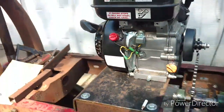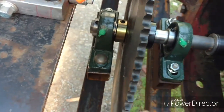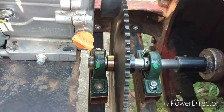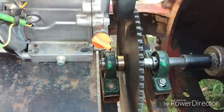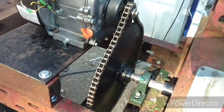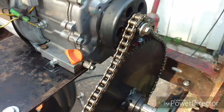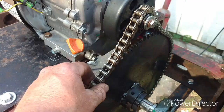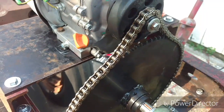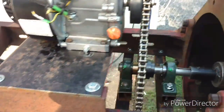I'm about to take my shorty pencil here and mark all my holes and get everything as true and square as possible. I'm about to mount this motor and I'm going to have to cut that spacer and make the chain. I got two ways I can tighten the chain — either I can put stuff under here and just raise the motor up, or I can slot the holes and move it from side to side, which as this moves to the side it gets further from the shaft and should tighten the chain. But that's more cutting. Rome wasn't built in a day — I just ran out of bolts so I got any 3/8 bolt that would fit. I need to make a trip to Tractor Supply and I will remedy all of that. So I got the engine mounted, used the same bolts that came out of the tiller. Got the clutch on, put a little spacer back behind. The clutch hasn't come off yet so we're good.